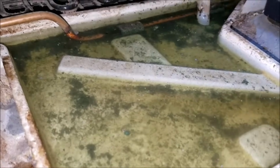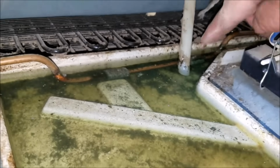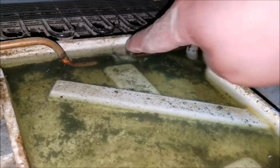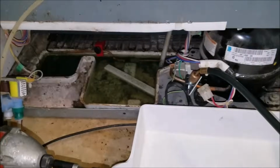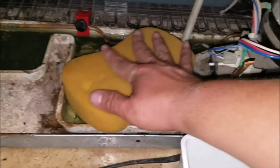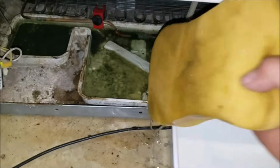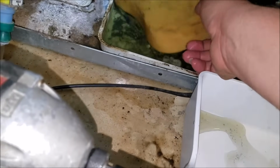Now, that's the pipe. That's the copper line that we have to replace, and we're going to cut it from there to this spot. And then we're going to replace whatever goes inside the water. And I believe it's water and copper. After a while, it doesn't get along. It just gets corroded. And the corrosion eats the copper until it starts leaking.